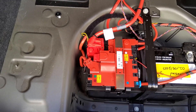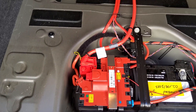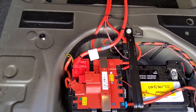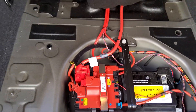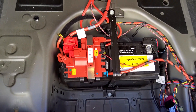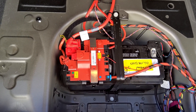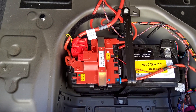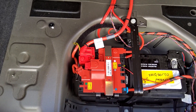The IBS will monitor the battery and tell us what the charge status is for the past five days. If you left your lights on overnight and it did drain the battery, it would let the technician know exactly what happened. It can also tell us if there's a parasitic draw. For example, on another car we had, when the car was off, locked, and asleep, something was turning on and draining the battery. The IBS caught that and let us know we had to look for a parasitic draw, pointing us in the right direction to find what was causing the issue.